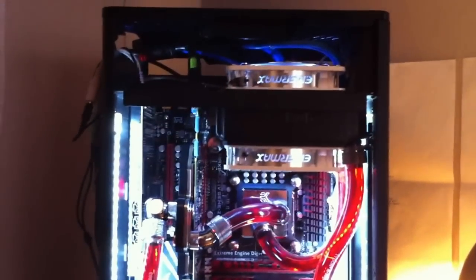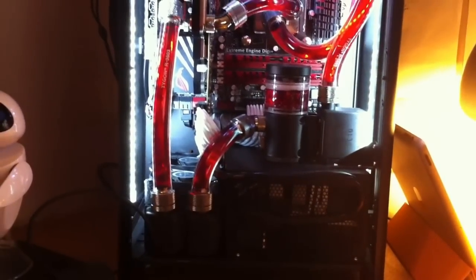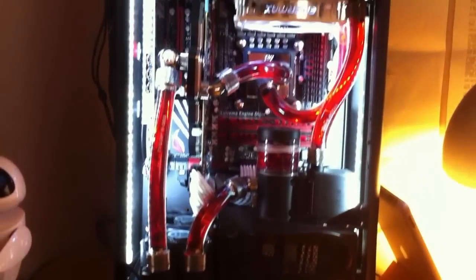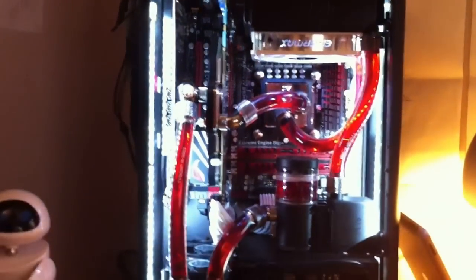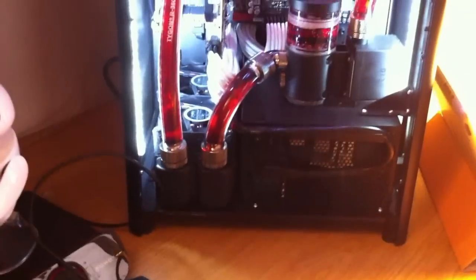To be honest, being in such a small case, actually fully water cooling it was really quite a simple process. The only modifications required on the case were cutting out the back part on the dual 80mm rad there, the bottom left, and taking out a bracket at the top right. Both of these were drilled out and dremeled out, and then everything fitted nice and straightforward.